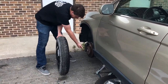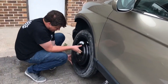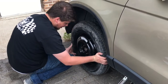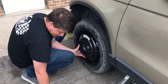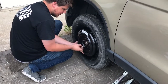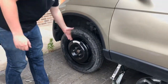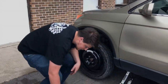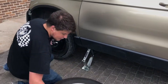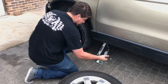Make sure the five holes here line up with the five studs there. Go ahead and grab the lug nuts — make sure you put them on hand tight; they should thread on easy. Now that your spare is on, you can go ahead and pull out the tire from underneath the car and begin to lower it with your jack.